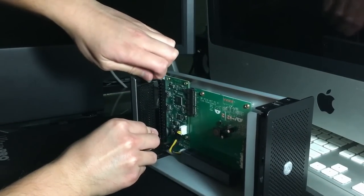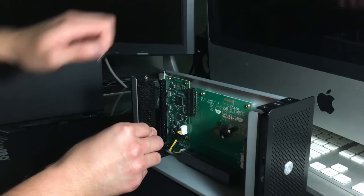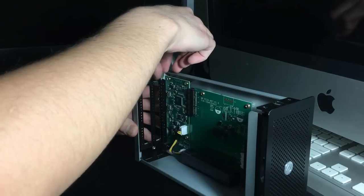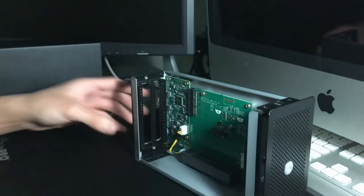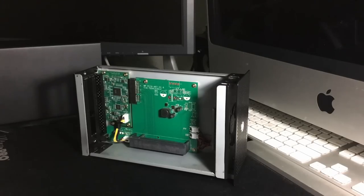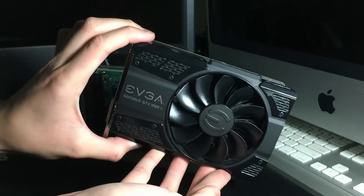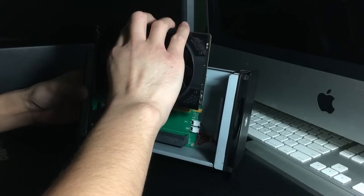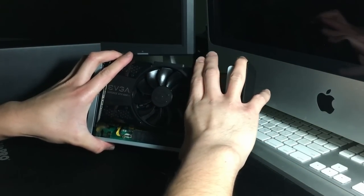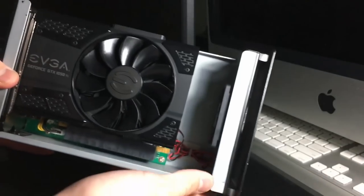Hold with one hand the bracket and unscrew with the other. Don't forget to take out the other thumbscrew as well. Here's the GTX 1050 Ti — you'll notice there's no power connector on it. I'm just being real careful here. I'm going to go ahead and use two hands, one finger on each hand, and push it down. I kind of shimmy it to the right, then the left, and it makes a nice clicking sound — I know it's secure. I'll show you the thumbscrew holes — that's how it should be lined up, as well as how the card should be fitted into the PCIe slot.